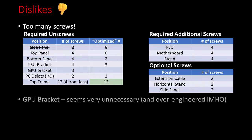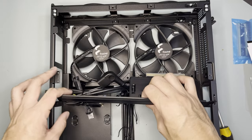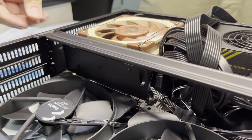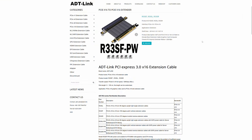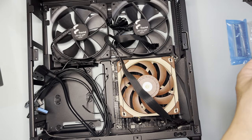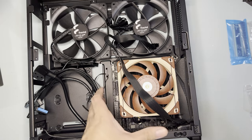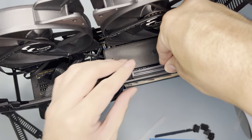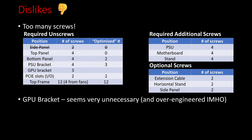As for the GPU bracket, this is another major dislike. The GPU bracket is not just a bracket but also contains a hard riser, which is a hindrance to motherboard installation. For me, this could have been simplified by using a ribbon-type 180-degree riser pre-screwed to the bracket, so you can install the motherboard without removing the GPU bracket. I also find it weird that I have to install an extension riser to the riser — why didn't they just build this together? Going back to the total screw count, it could have been 19 instead of 31 — a 38% reduction.